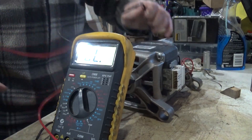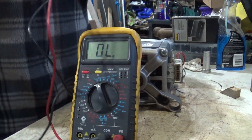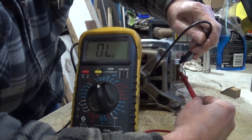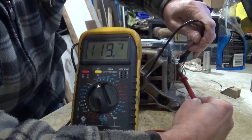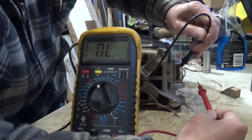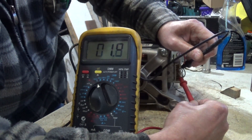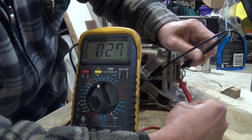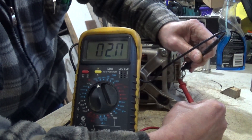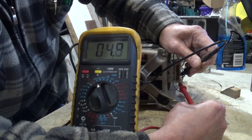Then we can run through and test. If I can untangle my leads — you can see there, if I go across the top two, we've got about 113 ohms. If I go across there — that's the top of the field coil — you can see we're about two ohms. If I go to the bottom of the field coil, you can see we've got two and a half. And if I go from the middle to the bottom, you can see I've got just about the same, 1.8 ohms. And then across the armature I've got about four ohms.